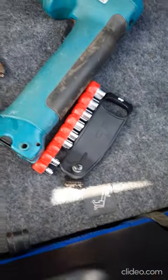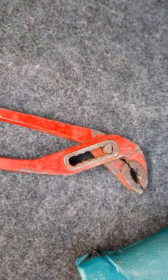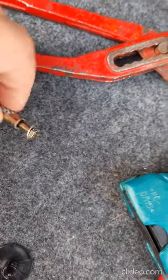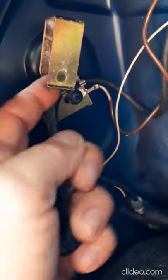What I did was first remove this plastic clip which is over there — just pull it off with the pliers. Secondly, I unscrewed this very tiny screw which holds the antenna over here. And then the whole thing comes off.